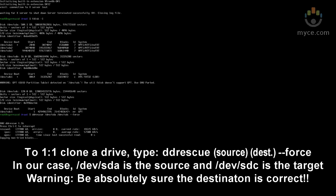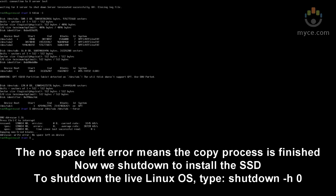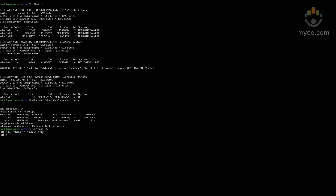For two drives of the same capacity, another way to tell them apart is to check which drive has partitions, as a solid-state hard disk, which is new, is usually blank. In this case, I previously used the solid-state hard disk, so it still has partitions present. While the target drive does not need to be blank, anything it does contain will be overwritten, and some solid-state hard disk enthusiasts insist on secure erasing the hard disk before reusing it.